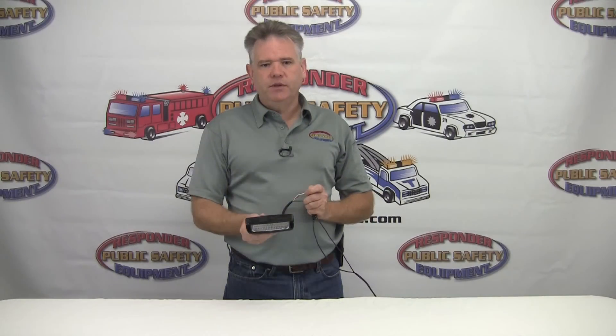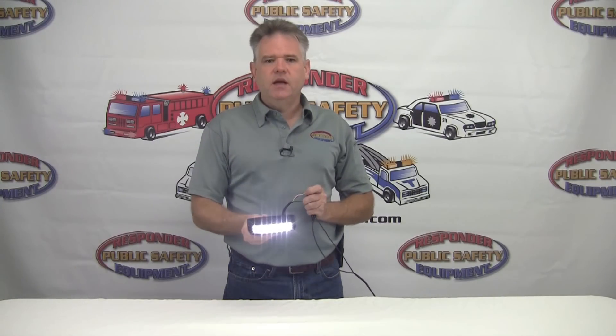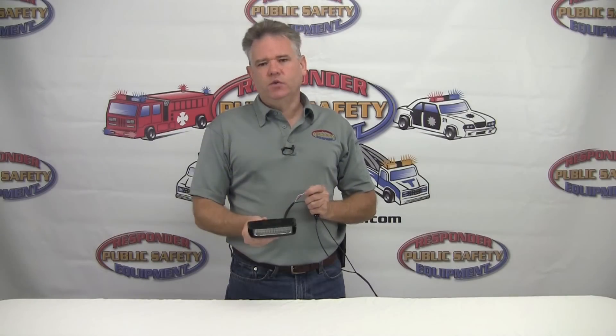In the dual-color model it's going to be 22 also, and in the single color it's going to be 12. One of the unique things about the tricolor light is its ability to be used as a scene light. By applying power to the white wire, you're able to steady burn the white color and use this as a scene light. This makes it highly effective and dual-purpose for emergency vehicle use — you're able to respond to the call, get the traffic out of your way, and once you get there at nighttime and need additional light, you've got it available.